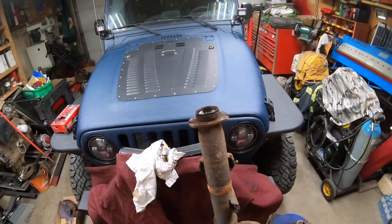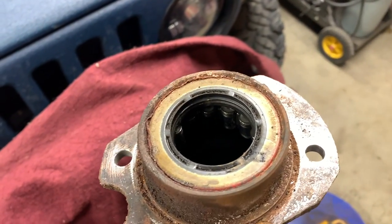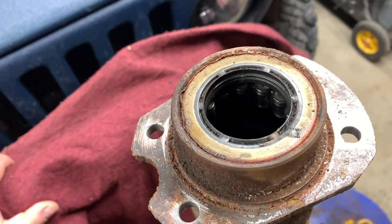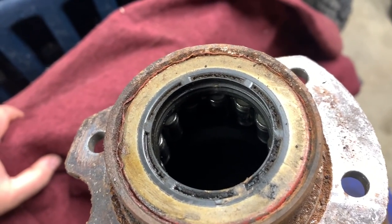She comes out violent — snaps your wrist, that's for sure. And this is just my opinion, but honestly if you have to go through all this trouble to remove the axle and take apart the differential to pull that seal, you might as well just replace the bearing while you've got everything apart.